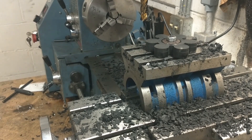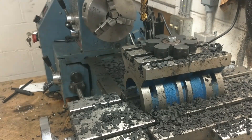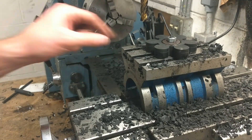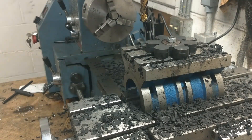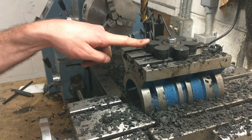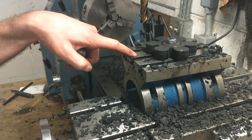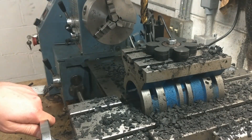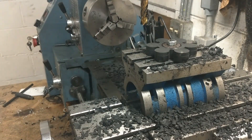I ordered a coupler. They don't make any more for the Tiger Shark, as any of you who have tried to replace them probably know. There's old used ones on eBay for about $50. I ordered this six-puck Yamaha one on a whim — it was $12 on eBay. It came in about five and a half millimeters too thick, so I threw it in the freezer overnight, drilled a hole in the center, bolted it down, used a five-eighths inch high-speed steel end mill, cranked it up to about 1500 RPM, and took the five and a half millimeters off in one pass.